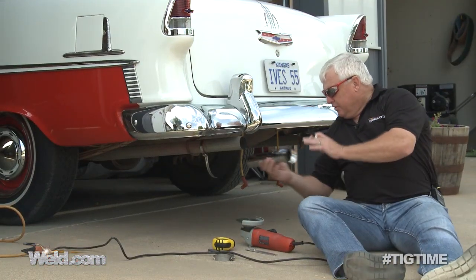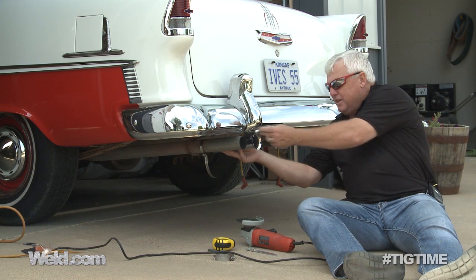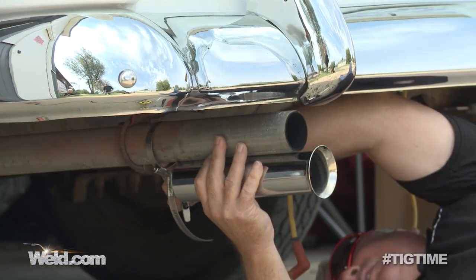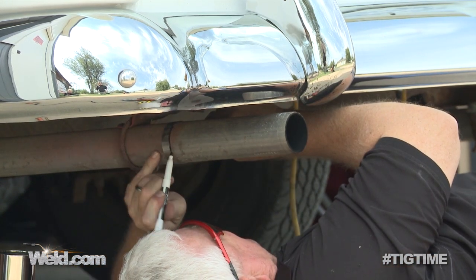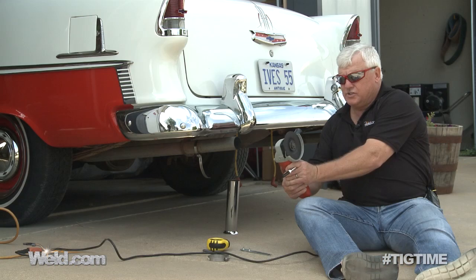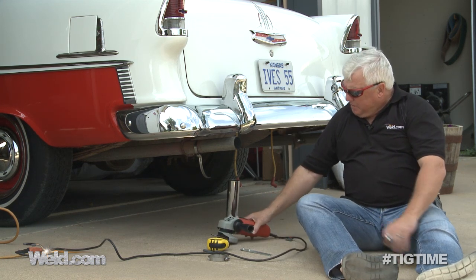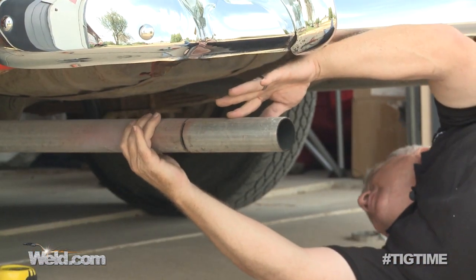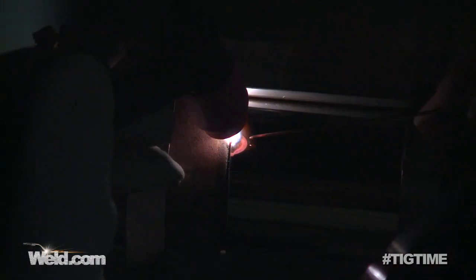I've got a measurement here for where I'm going to extend this pipe — about an inch beyond the old pipe. Of course this one's chrome and it looks pretty cool. I'm going to make a mark — that'll be my cut mark — and once I make that cut mark I'll make a 360-degree cut mark. I'm going to do an abrasive cut. Be very careful, make sure you put your eye gear in place. There are several ways of cutting metal; this one's got a very thin abrasive wheel. I'll slit right through it, drop the bracket, the whole tailpipe will come down, I'll finish it off, square it off, put this in place, TIG-tack it, and then weld it complete.